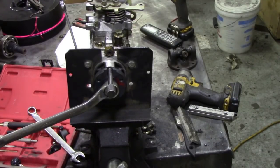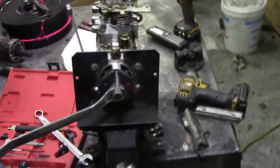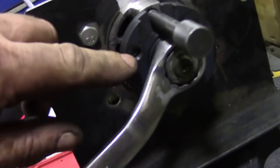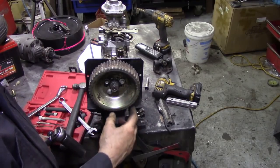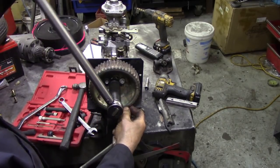So now we know that is in its correct place. If you don't believe me - there we go, spot on. Now all we have to do is tighten up the nut - that's more difficult than it appears because again we don't want to over-tighten against this aluminium housing. So I'm going to make a little bracket to go in there - an old pulley or something just to lock that up. I've temporarily put an old pulley on and I'm jamming it against the base of my stand with the timing pin, and we're going to tighten this bolt up so hopefully the pin won't move.